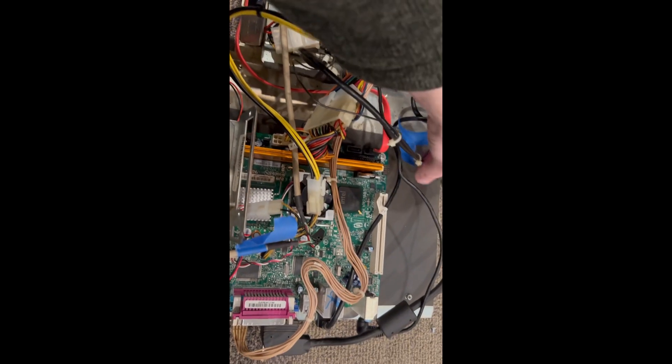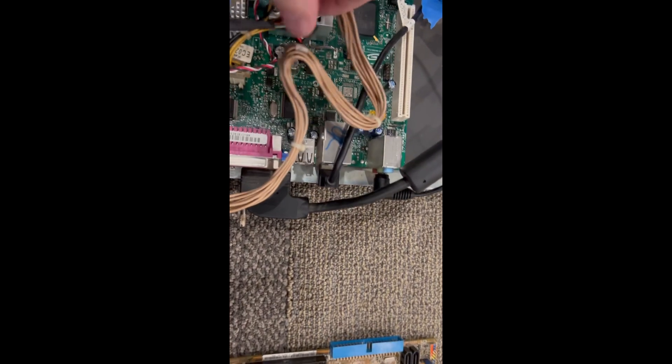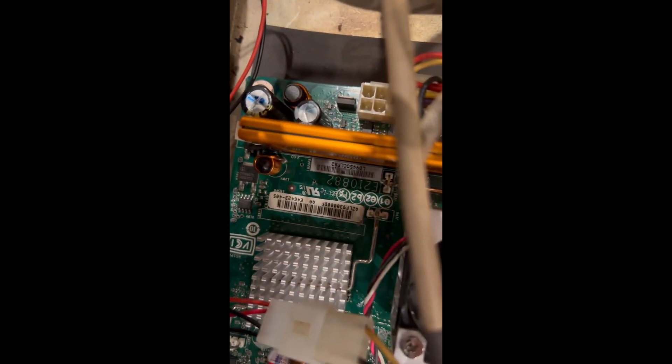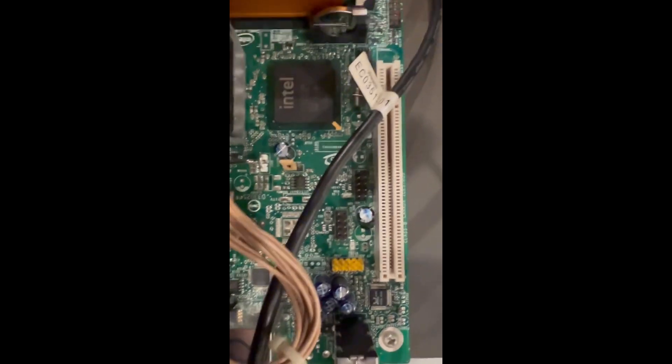I'm trying to wire this back up. It's a little confusing on where these connectors go. I had labeled these before I unplugged them — USB 5, 6 is where it came unplugged, and then there's another USB. I looked at the manual online and found that the M and L markings you see are both for USB, which are these two. You can Google the model number — it's LD945, et cetera. There's a blank pin — you can see where it's missing a pin — and you're just going to line these up. You can see how it's got a spot that's blocked out, so you line the blocked-out one up and plug your two USBs in.